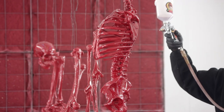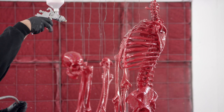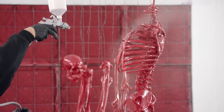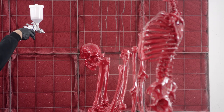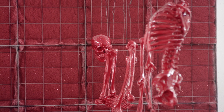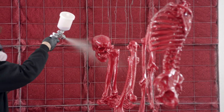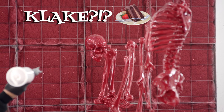And the other thing is, when it's still small enough that when you put the clear over this prismatic, you really don't have to do any color sanding or anything. But it has a big, big look. Well, shooting it liquid, it's not going to stand up as much. We're going to get a lot of flat surfaces rather than the dry process. So that way we can bury it with a flake afterwards.